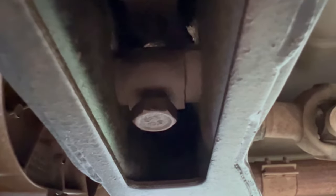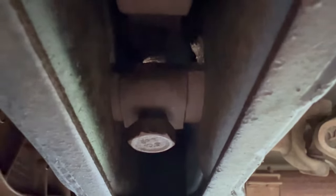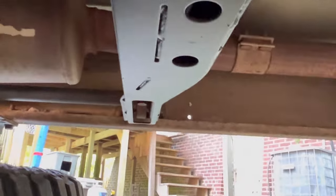You want to go ahead and unload your torsion bars on this truck before taking that shock absorber loose. It's got a key right there that holds tension via that bolt. You don't want to try to loosen this while the truck is sitting on its wheels because you'll mess it up. Go ahead and loosen this torsion bolt here and another one right over there before removing the shock absorbers.